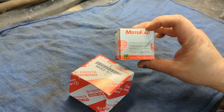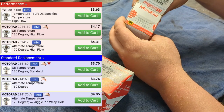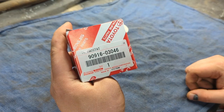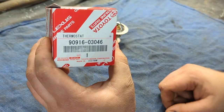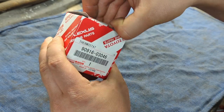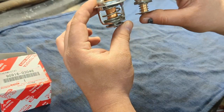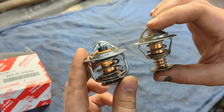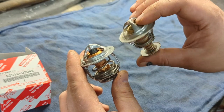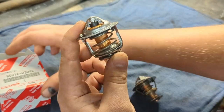While we're waiting for fluids to drain, let's talk thermostats. I know you guys are all going to hop on RockAuto, use a discount code from the Tercel four-wheel drive forum, and find thermostats for like three dollars thinking it's a great deal. But look at the quality difference side by side compared to the Toyota OEM thermostat. I bought the OEM off eBay for twenty-four dollars — they're about thirty-five on Amazon. I was running cheap aftermarket ones in my '85 and had a couple back-to-back get stuck closed or stuck open.